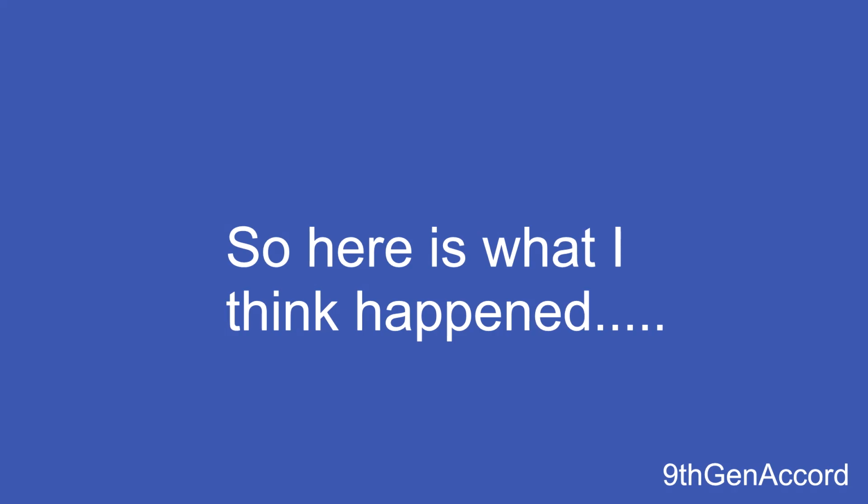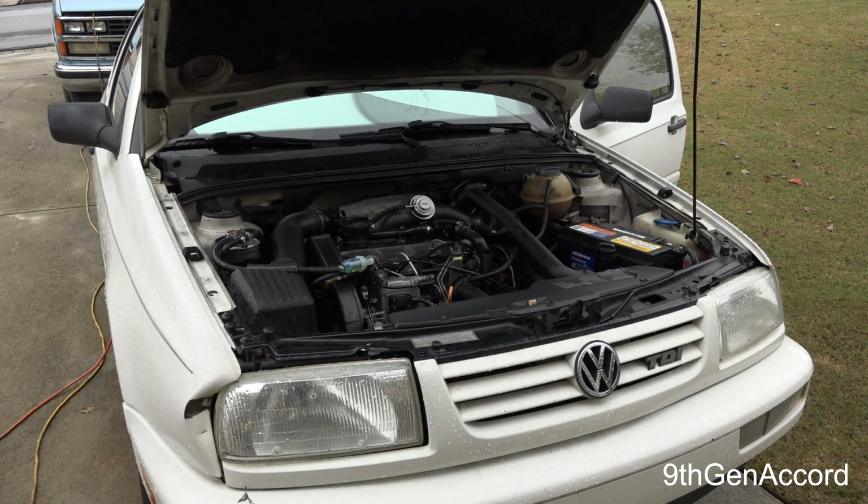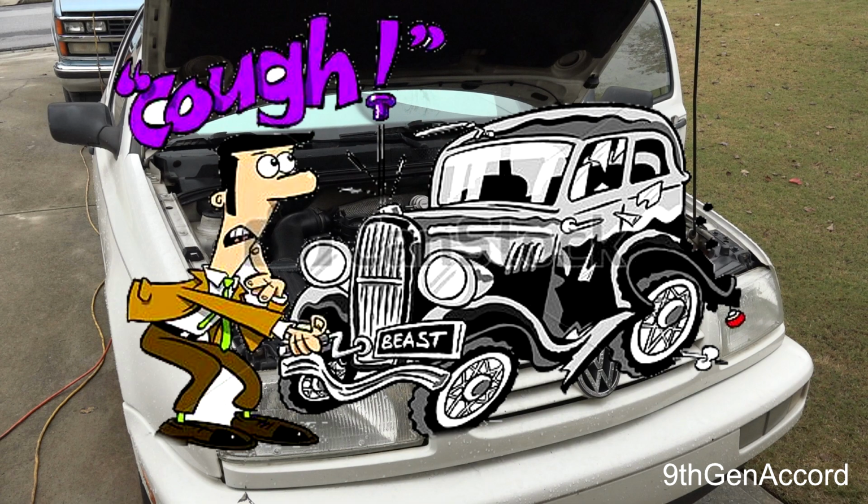Okay guys, so I wanted to give you a synopsis, an overview of what happened in a timeline that I think caused the symptoms and the failures on the Jetta. At the very beginning, if you watched any of these videos, I was having trouble starting the car in the morning. It would take about 10-15 seconds of actual cranking before the car would fire.